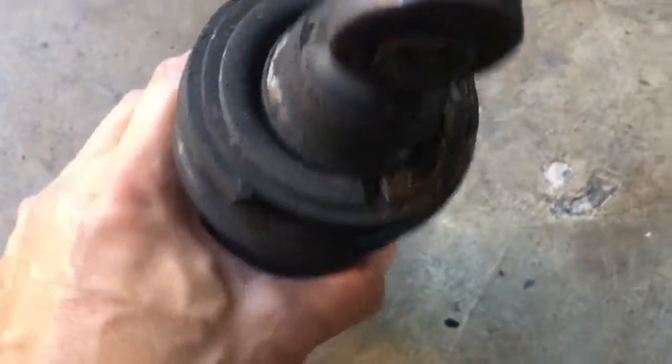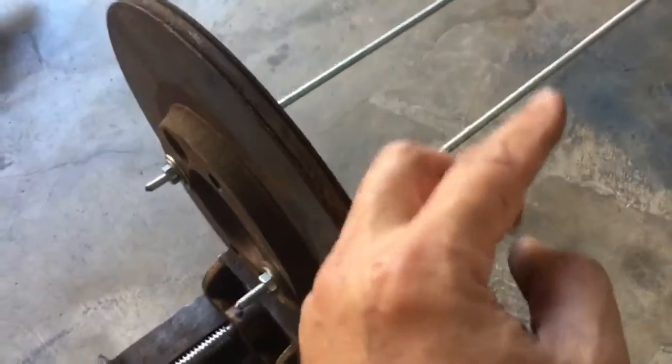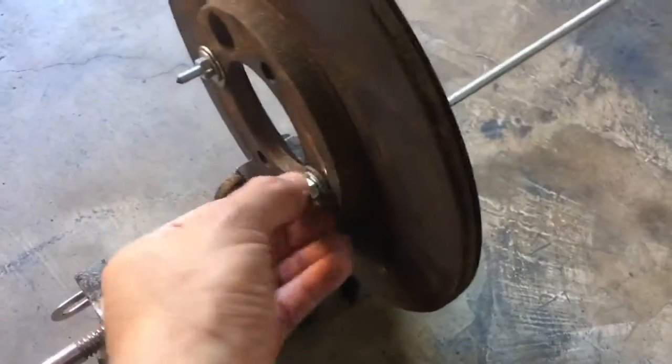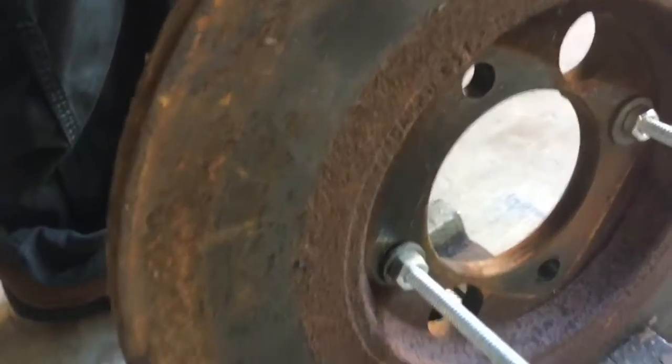and there's a trick where you put it between the brake rotors, because the top hole of the brake rotor fits over those clips, compresses the spring, and lets it out. But it's all kind of trapezy. So what I did was got these big washers down here to take the load, and then I put some here so that it's all stable.